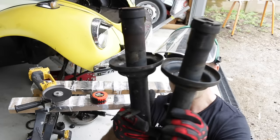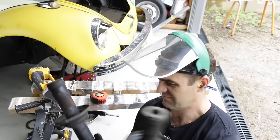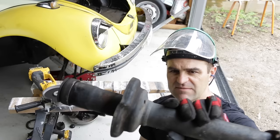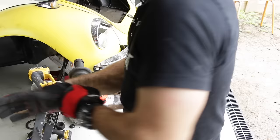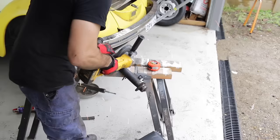Quite interesting — doing my measurements I find they're not actually the same height. The driver side is already about 10mm lower than the passenger side. I'm going to cut and weld them to the same total length. It also looks like the passenger side has possibly been cut and welded before, whereas the driver side hasn't. The driver side also has flat mounts at the base whereas the passenger side is curved all the way around. Either way, I'm going to try and even it all up now.